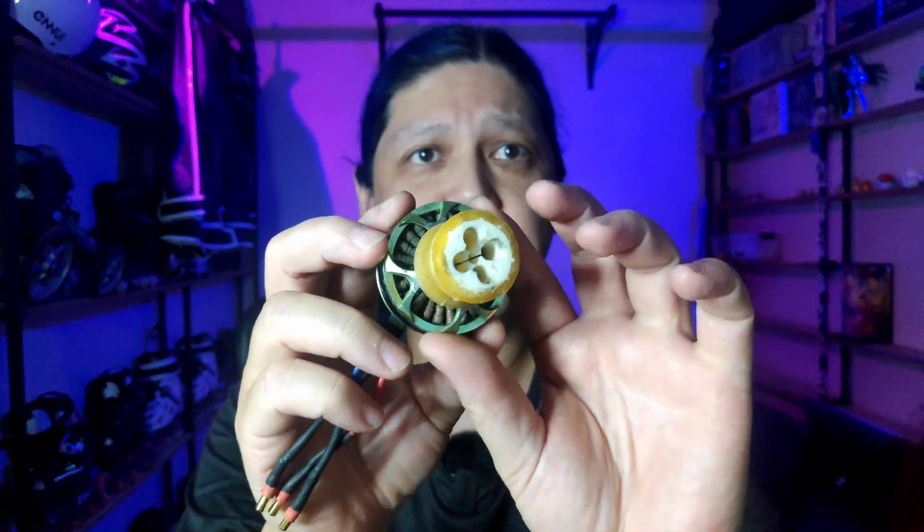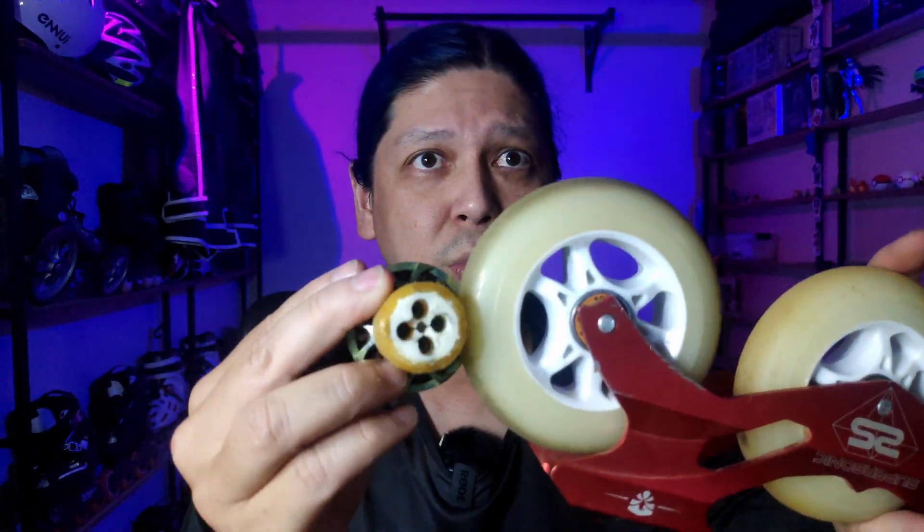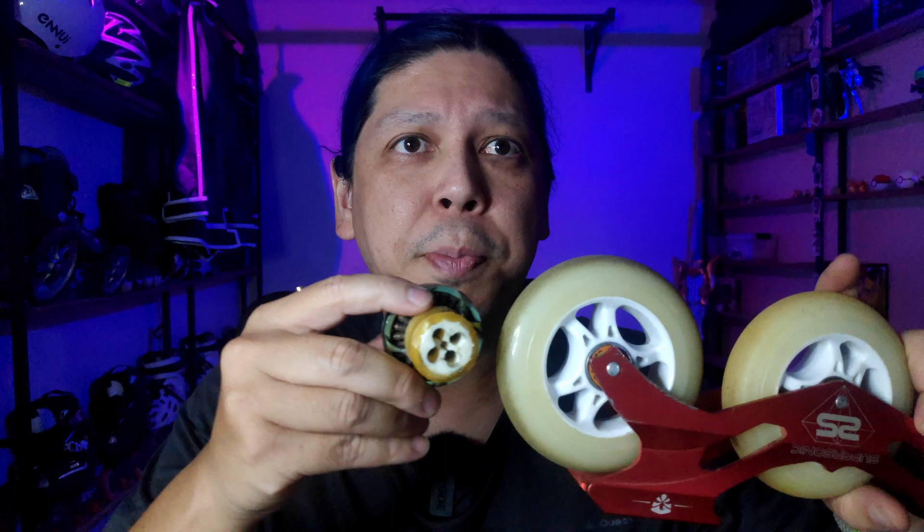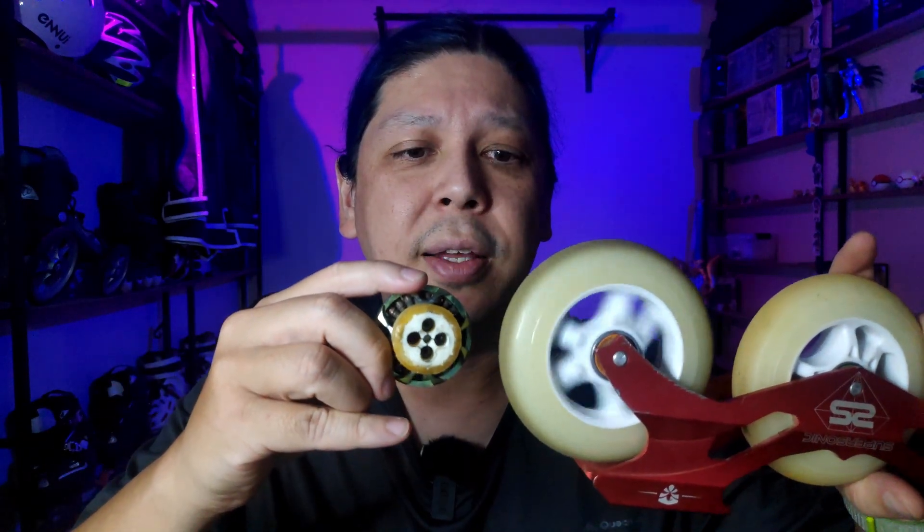There's even better news — with friction drive, you actually press the drive part against the wheel to have friction, but at the same time you can push it back and let the wheel spin freely. This means when the motor is turned off, you have a free wheel — Thunder Blade just turns into a normal inline skate. The third advantage of the friction drive system is that it's really lightweight, because there are no moving parts other than the motor — just one small part to get the drive system to work. And the motor itself can be smaller because of the really big gear ratio.